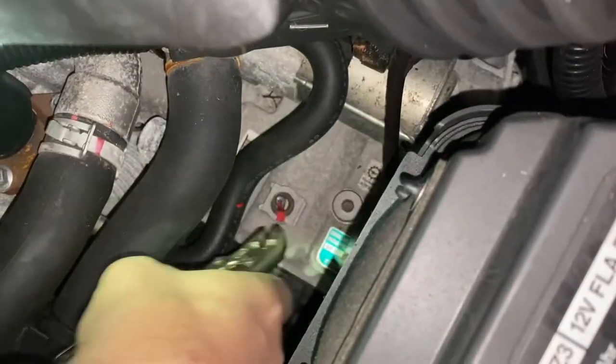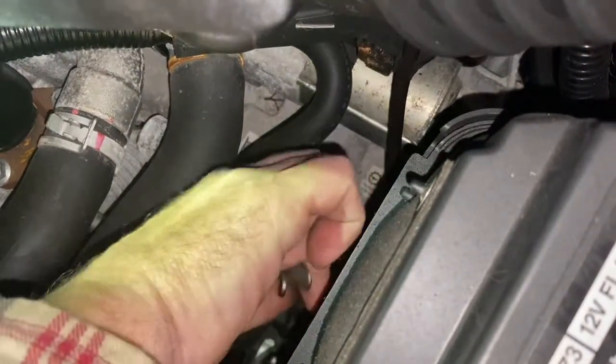We've gone to vice grips now. You guys can see in the video we're using vice grips. Now obviously Honda makes a tool, but we didn't have a week or a week and a half to wait for the tool — we just needed to move the van quickly and get it into neutral. So we use vice grips, which isn't going to be a problem if you know what you're doing. Obviously you don't want to mess the threads up. Don't mess up the squared off part of that shaft.